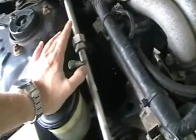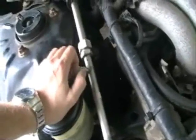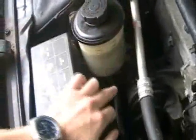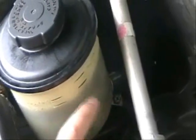It's not a difficult job, but it's time consuming, especially if it's your first time doing this. You also have a few hoses. Here's one hose that runs to the pump, and for Maxima guys, this is a 24mm nut right here, and then you have another line that runs right here to the power steering reservoir.